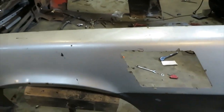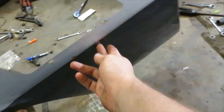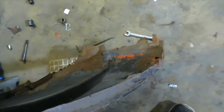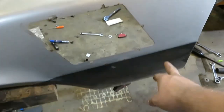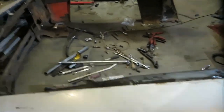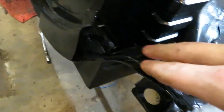The first step to setting up a tilt front end is figuring out where you want to cut things. We're cutting right here along this body line all the way across. We're going to leave the bottom half bolted to the car since there's one bolt hole left. Basically this gray silverish part is what lifts up - it separates from the bottom half of the fender right there. You can put some weather stripping right there after you cut it, same thing on the other side. Try to keep it as symmetrical as possible.